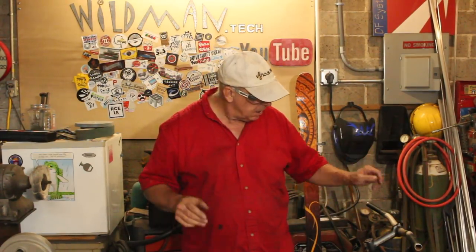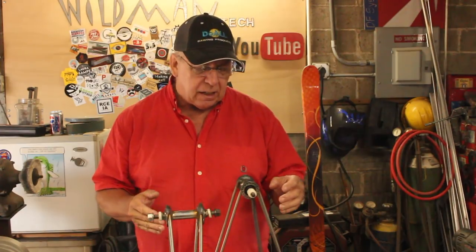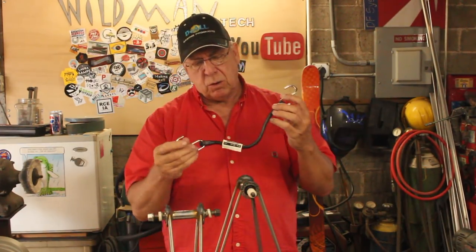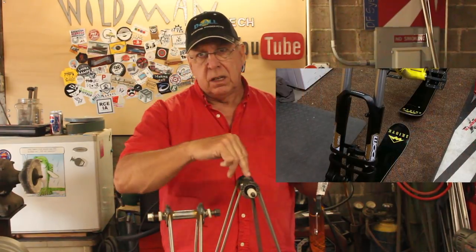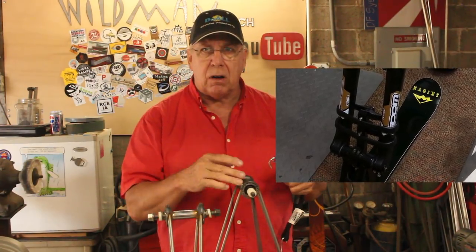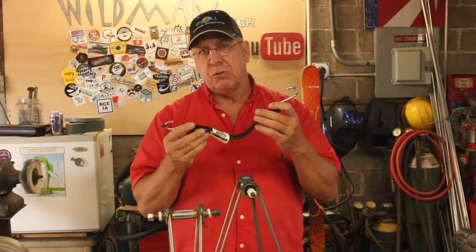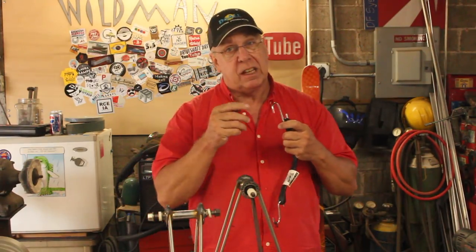That's looking pretty good. All I need to do now is install those limits so the skis don't come up too far in the front and the spring retractors to keep them up any time there's no weight on them. A friend of mine came over and took a look at the ski bike and offered a suggestion about the return spring idea. The way they did it on his was they took a rubber bungee cord and wrapped it around the frame, then attached it to a bar that sticks up. I stripped the whole thing down thinking I was going to weld that bar on, but then I thought it would be way better if it was adjustable. So making that bar adjustment and tying to these rubber bungee cords is the next step — that's almost the last thing I need to do.